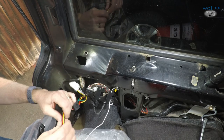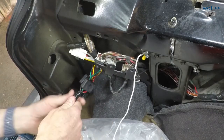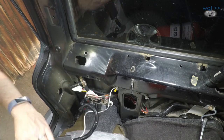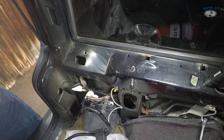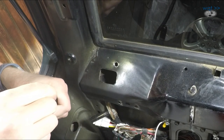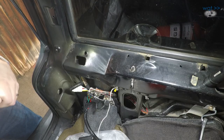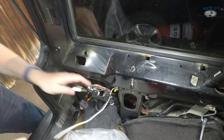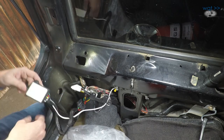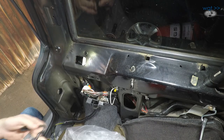It'll go a whole lot better if I can actually fold it. Then from here I'm going to do the same thing coming back down to here-ish. Since I don't need a ground on this point, I'll just take a little bit of this black nail polish and goth up my Jeep here. Black paint would be fine too, but this stuff dries really fast and it forms a nice hard shell. We are now 0.5% less likely to lose this Jeep from rust. Wiring done. So I guess the only thing left to do is peel the sticky back here and loop this under.